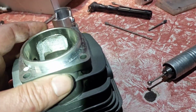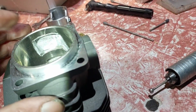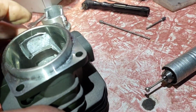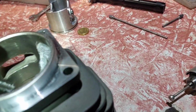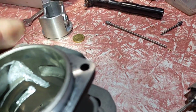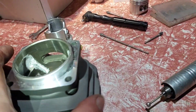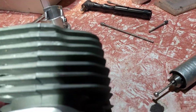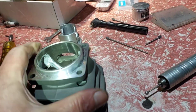So yeah, tonight that's all I can really do. Add this up on the sides a bit, give more case capacity. I'm working on the upper transfer. I have given them a snake tail, the very tip here on both sides, with a diamond bit. So that should flow a lot better. So that's the upper so far. Haven't done the intake, nothing like that, nothing to the exhaust. I'll just put the flap wheel on the saw and work out from that, but I'm happy with that.